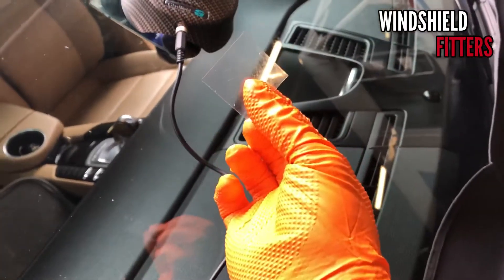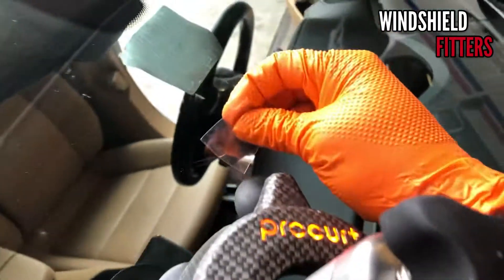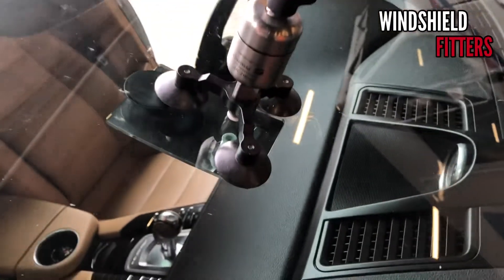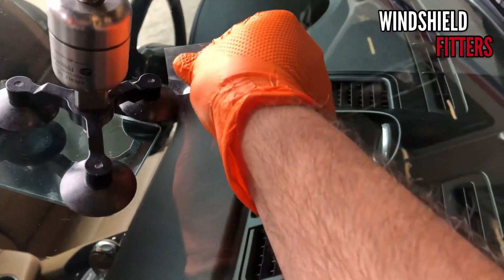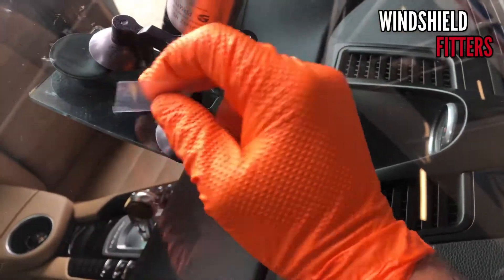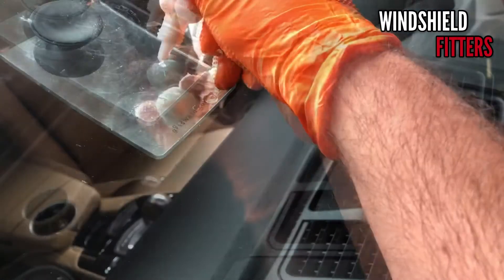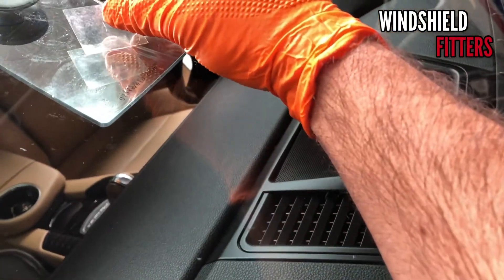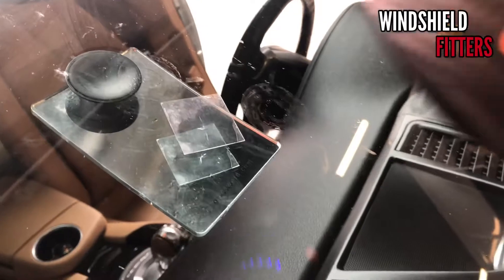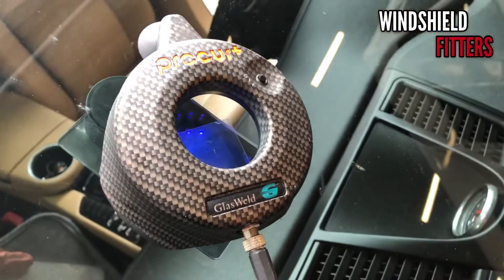Using this technique, I get a little plastic cover and put it on the suction cup — it easily removes it. We're going to release some of the pressure on the machine. Then apply the filler resin — put it on the impact point. This is a thicker glue. Put it on top and place our ultraviolet light again on top of the area and press the button.